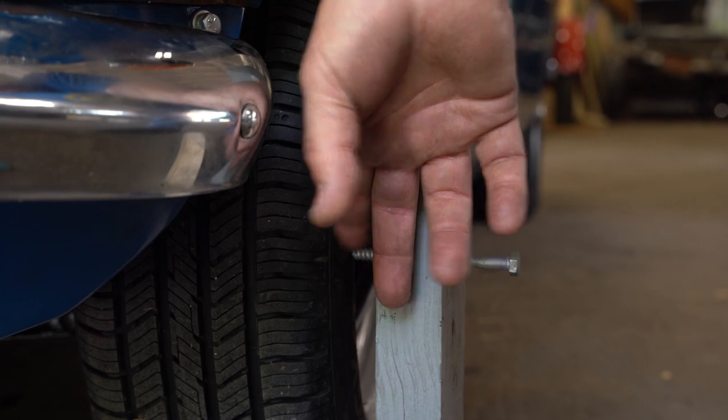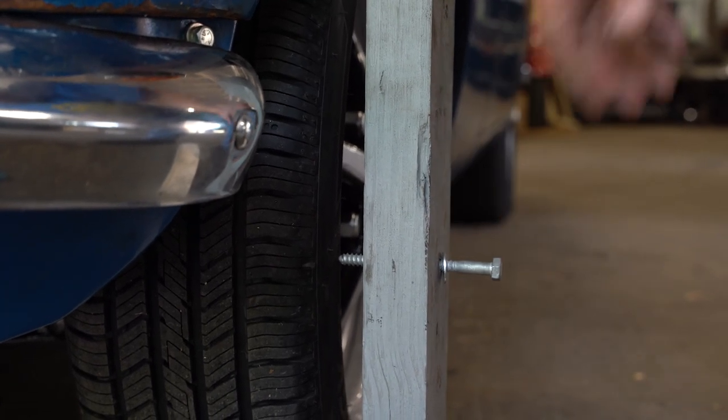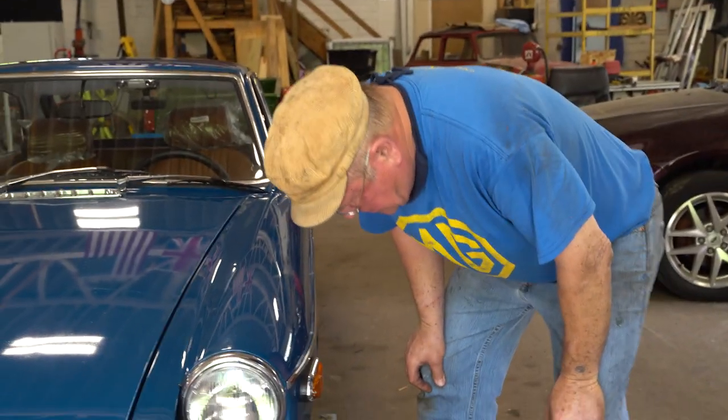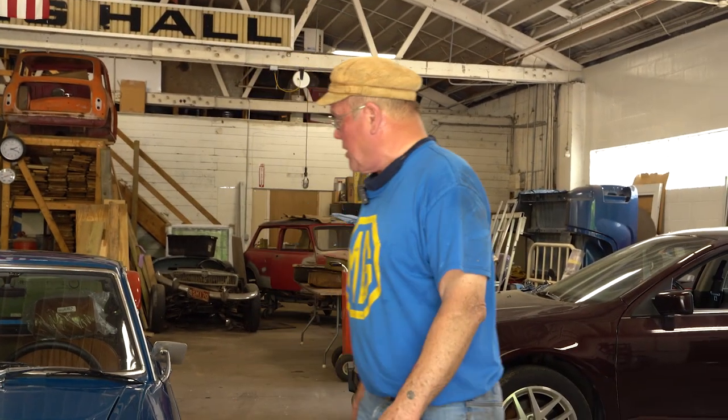that's the setting at the rear. So this is that close. So I'm gonna put about a quarter of a turn in to give it just a little more toe in and lock it down there. Then we'll continue getting the steering wheel straight.